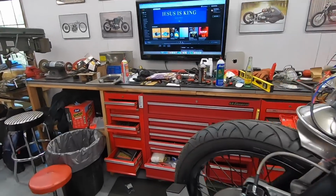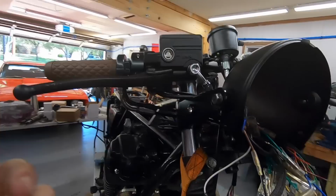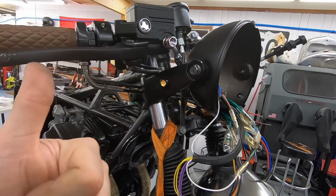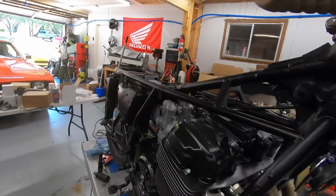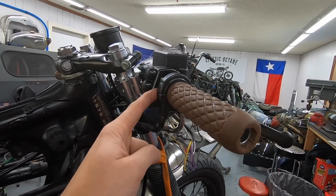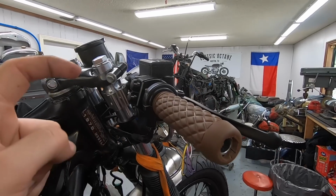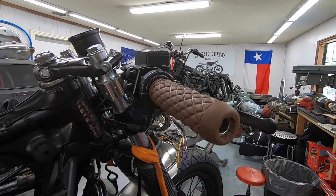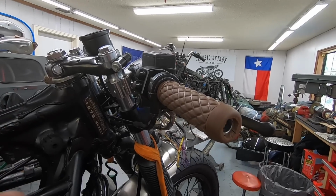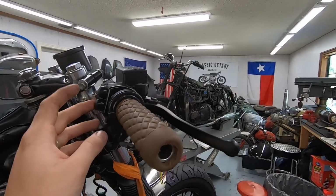The next one is going to be the start switch. So start is a key on power, again, black to one side. You're gonna want this one to be the momentary switch, so the one that you have to hold down for it to make connection, and when you let off, it lets off. Otherwise you could click on and then your starter motor is just gonna keep running after the bike starts, and you definitely don't want that to happen. So you want this to be a momentary switch.